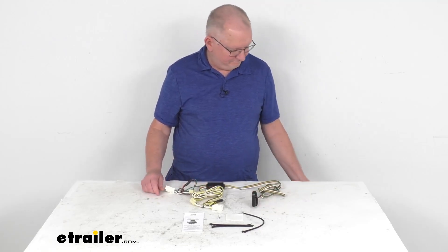When you go to install this, head to the rear cargo area. It comes with a nice set of instructions that will describe where those connection points are. You'll take these T-connectors — the one with the yellow wire goes on the driver's side of your vehicle, and the other T-connector with the green wire is for the passenger side. Plug that in, and with both those plugged in you'll have this white wire with the eyelet on it that needs to connect to a good clean ground.